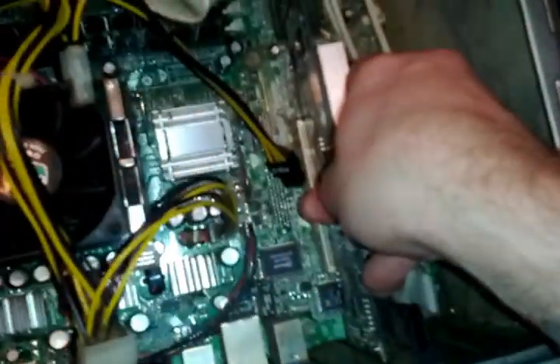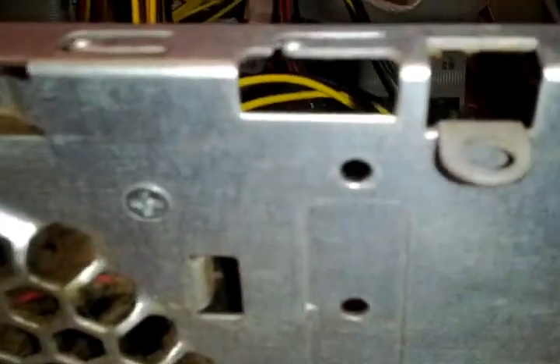What I'm going to do is put the NVIDIA video card back in the open slot. It lines right up just like the RAM does — push it down until you hear that click. The lines line up and the plate goes back on.